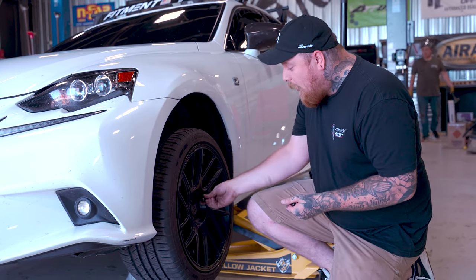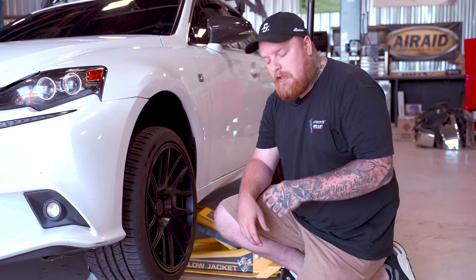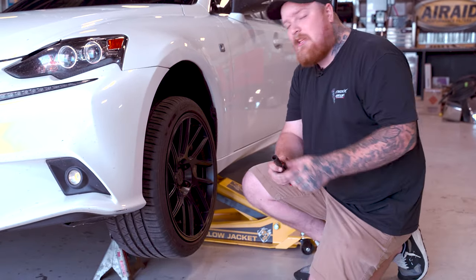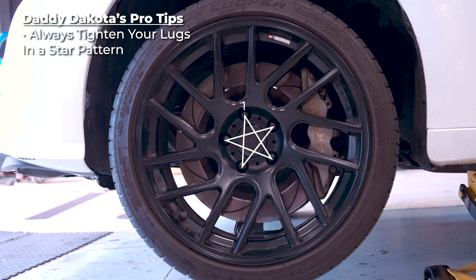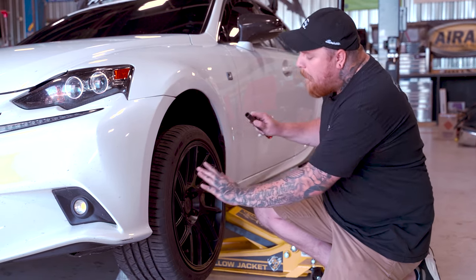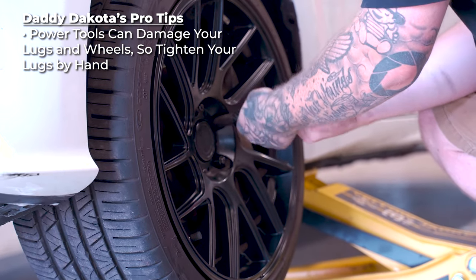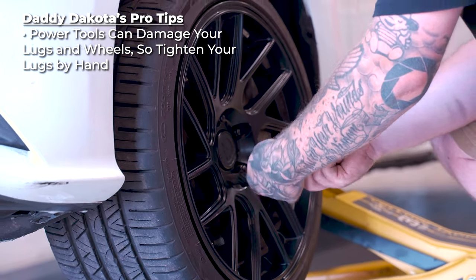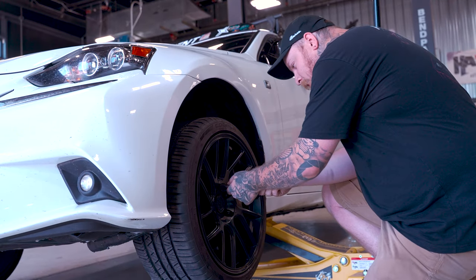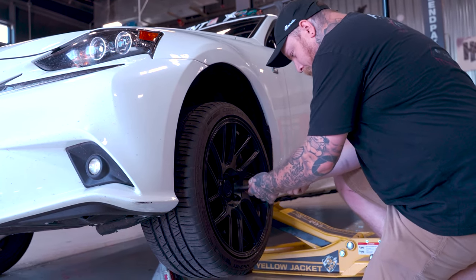Cross-threading is going to make everything terrible, and working on cars doesn't need to be terrible — you just got to do it right the first time. I've got these finger tightened. Now I'm going to take this tool and tighten them up so they're a little more snug before we do our check. When you're tightening these down, do the star pattern — go across from each lug nut in the shape of a star so you're getting an even amount of pressure on each side. Also, I would definitely not recommend using power tools. Power tools can damage your wheels, and they can over-tighten or under-tighten. It's better to do it by hand — it takes a couple more minutes but in the long run it's worth it.